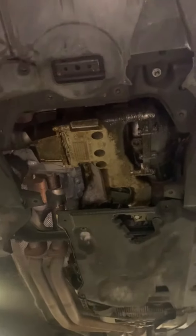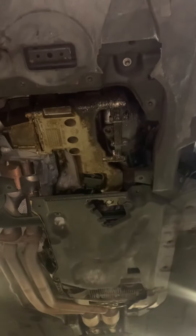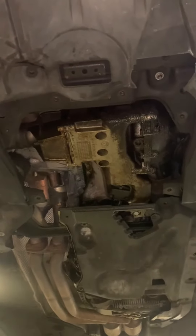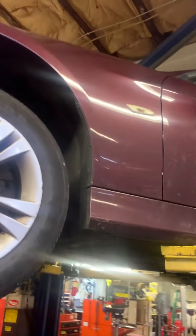This is a way to convert the car from four-wheel drive to rear-wheel drive and keep the budget down. To fix it properly and keep four-wheel drive is about four thousand dollars. This conversion — labor and programming — is probably around fifteen hundred dollars, and the car will actually be better on gas with no more axle problems. Of course, no more four-wheel drive. Hopefully this helps.